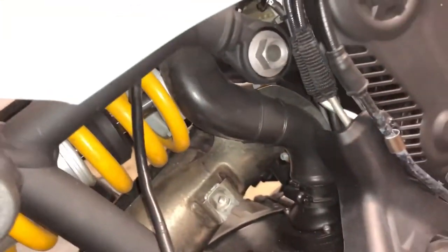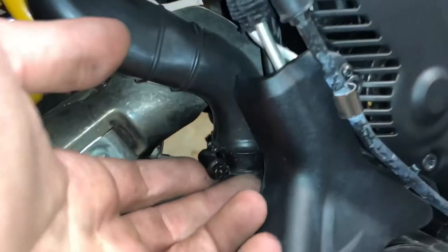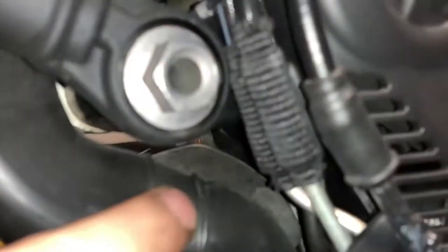I also took the seat off just real quick — if you have one of these bikes you just stick the key in down there and the whole thing pops out. Got some more light coming in. This is the oil vent tube right here — you can take that off right here with this clamp. I'm gonna remove this clamp and attempt to pull this off to the side so I can get to that head pipe bolt right there — there should be another one up behind there too.